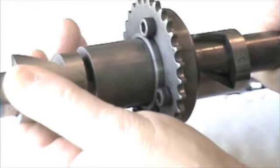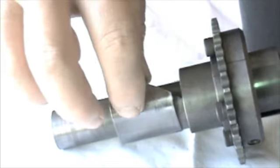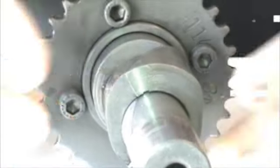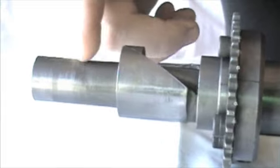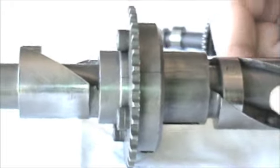Because it's a very small engine, it's only got this one inch or 25 millimeters of movement to give 85 degrees. But this helical adjustment method has actually no limit to where it can go. It can continue until the opening flank of the lobe and the closing flank actually open out so much that they're completely out and it meets itself, so you can get 720 degrees on it. But in a typical normal car engine with about a three-inch bore, you'd probably get enough length to get 100 to 150 crankshaft degrees of duration change.